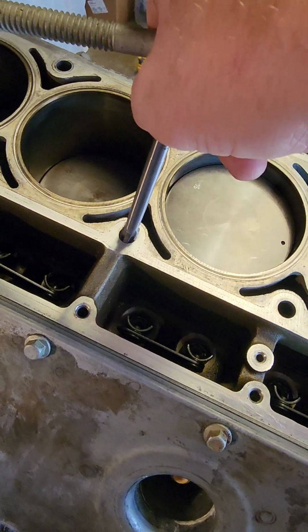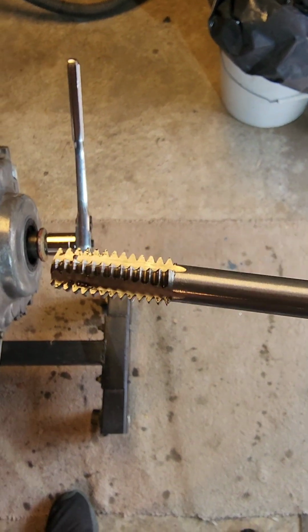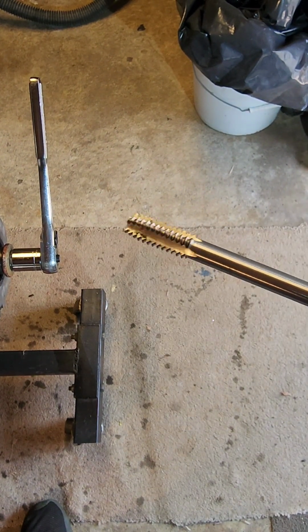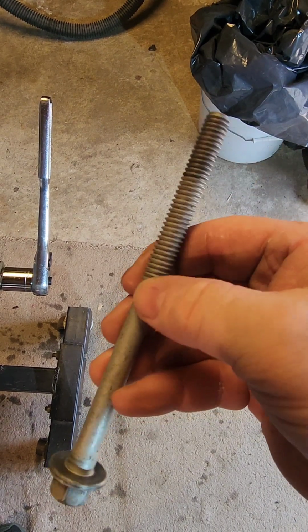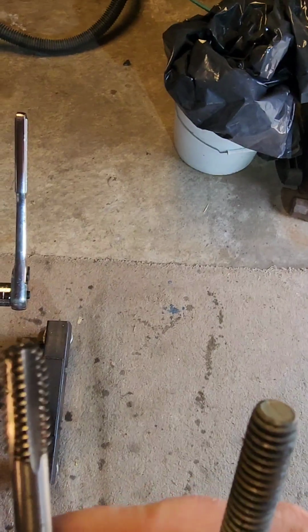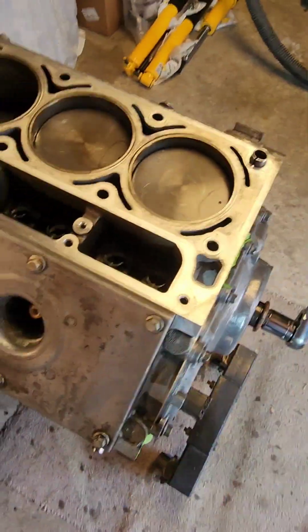So this is the second time. Like I said, I'm very careful. Not a whole lot on there. A couple of the baby pieces. But if you didn't have this tool, or can't get one, you could take the factory bolt and cut grooves down it with your grinder, 180 degrees from each other. So you put 2 grooves down it. This one has 4. But you could put 2 on your factory bolt and use it as a cleaner, but definitely clean out these holes.